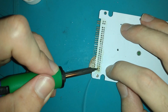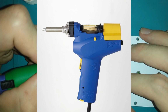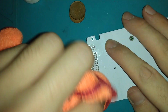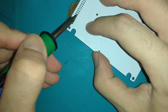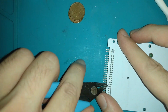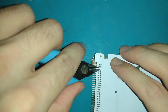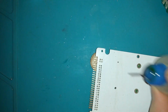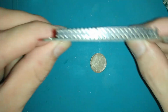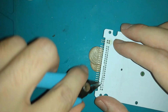The cleanest, easiest, most thorough way to do this would be to use a desoldering gun on all but the furthest two pins on both edges of the interface. By keeping a total of 4 pins soldered to the PCB to act as anchors, the rest of the pins could be trimmed flush, then resoldered. Once those 40 pins are soldered back in place, the 4 anchor pins could then be desoldered themselves, trimmed flush just like the rest, and resoldered just like the rest.